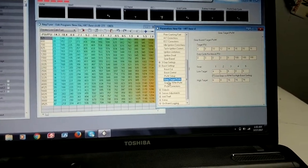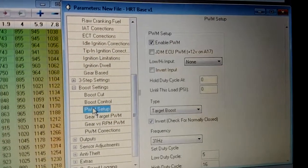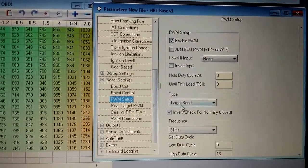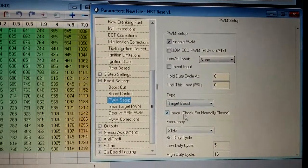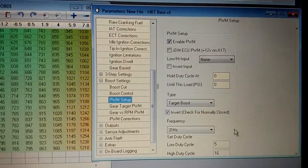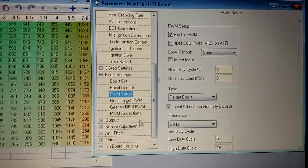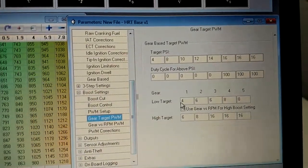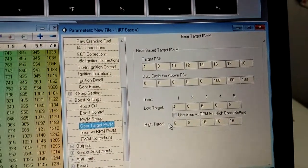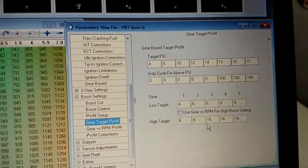There's where I've been messing with my boost controller — the boost solenoid. I went ahead and enabled it, did a target boost inverted, put it out at 31 Hz, and my duty cycles are at 16 and 5. I believe these are the PSI I want to be at. I did low targets for first through fifth gear and then high targets for first through fifth gear again, with the high target being 16 pounds since that's what it's tuned at.